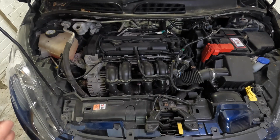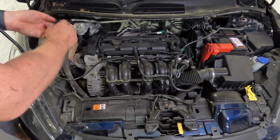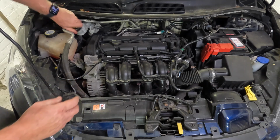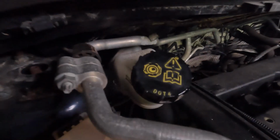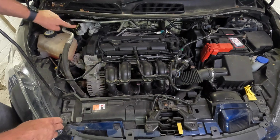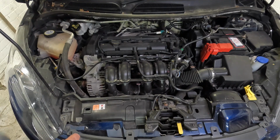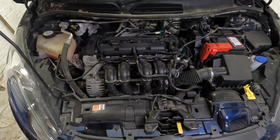And it is important to ensure you put the right brake fluid for your car in the reservoir. And it says quite clearly on the cap that this takes DOT 4 type brake fluid, so when you are replacing brake fluid, always use the DOT 4. But be careful when changing brake fluid not to get it on the bodywork, as it is corrosive and will destroy your paint.